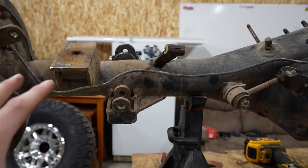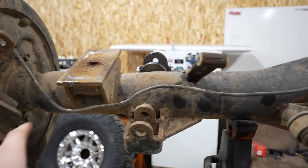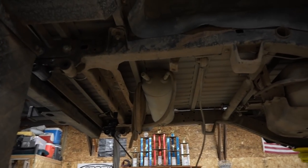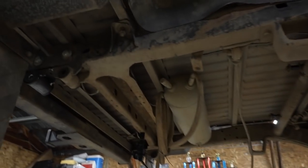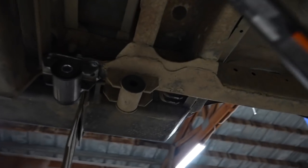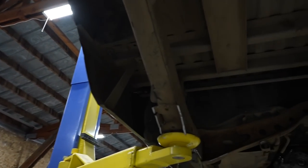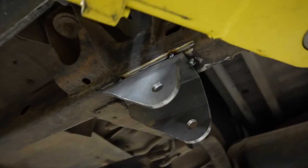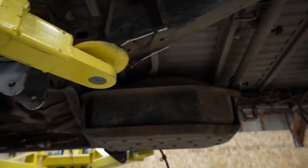As you can see, these are the back tabs they had for shocks on a previous build, so we need to chop those off. I want to straighten these brake lines and do a bunch of work to the axle, but we'll save that for a separate video. Right now we're working on the frame. Now that the axle is out we can start cleaning this — I want to throw on some spray paint and touch it up a little bit. We still need to cut these brackets off, finish touching things up, clean those, and then we've got to finish weld the brackets that we installed, and of course paint.